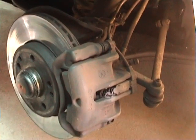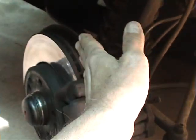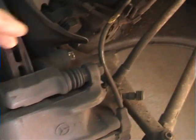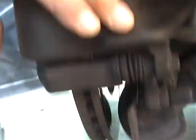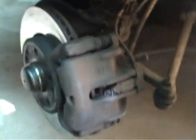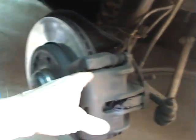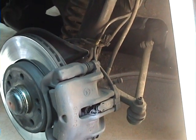We got the car up on the stand, the wheel off. I turned the wheel on an angle like that so it makes it easier to get at the brake caliper bolts. You need a 19mm socket — there's one bolt here and another bolt there. We're going to unbolt the brake caliper, and I have a piece of wire to tie the brake caliper up out of the way so there's no strain on the hose.